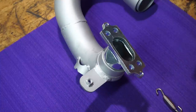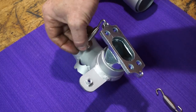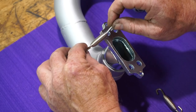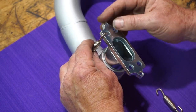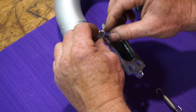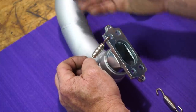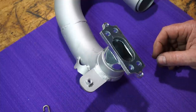Mounting of this flange and the springs. Now, everybody's putting the springs on the outside here, as BGM have designed it. But when you do that, your cowling has to be completely cut away to stop it fouling on the springs. So we're not going to go down that road — we're going to completely change it. We're going to mount our springs flush. So that means I'm going to notch this manifold here, so the spring sits in here flush. Once it's bolted up, it can't come out — it's then a captive spring. That way, we don't have to cut away the cowling. The original cowling can fit and maximize the capture of air in the cowling, so we keep the engine cool.